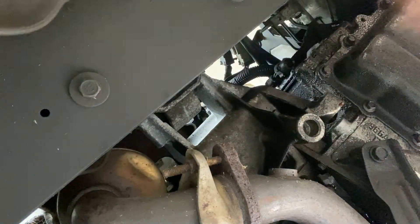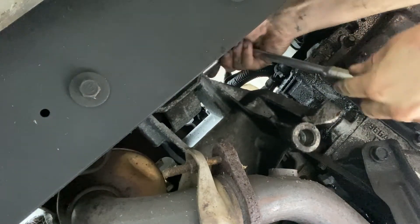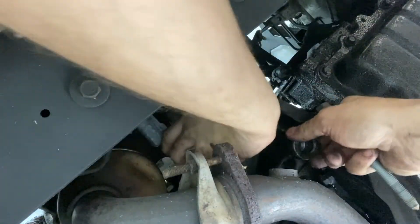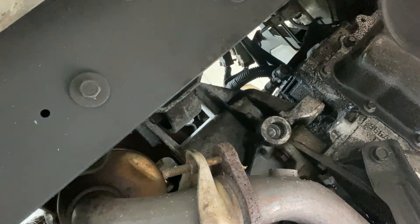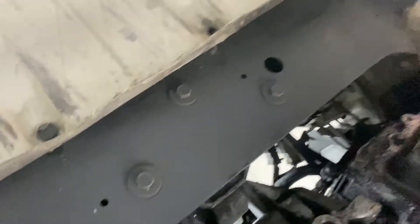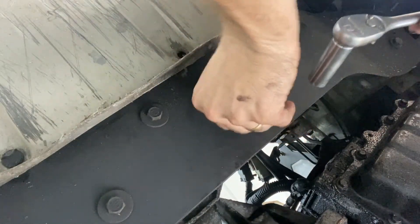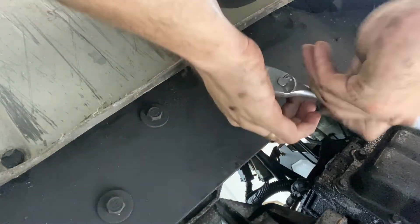The engine hasn't tried to fall out of the car, so that's good. We're going to see if we can get this bolt out and see if maybe, just maybe, this thing will slide out of its little hole so we can access the starter fully. Of course not. Which means plan B — these three bolts hold this mount to the frame, so let's go ahead and rip these things out. And if you're wondering why I'm not using the air gun — I haven't finished running the metal airlines across the shop yet, so we're almost there but we haven't done that yet.